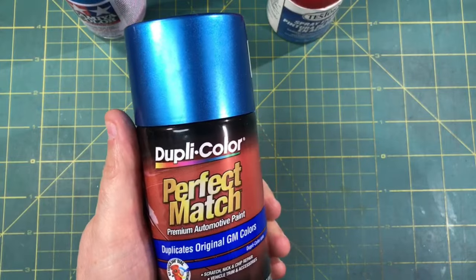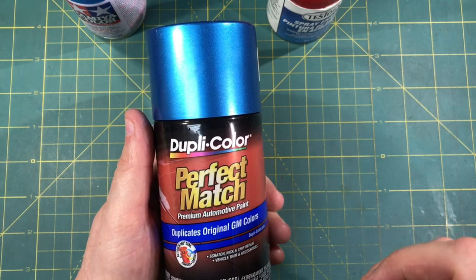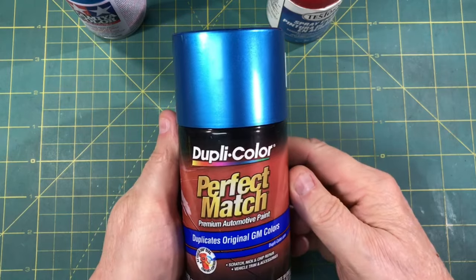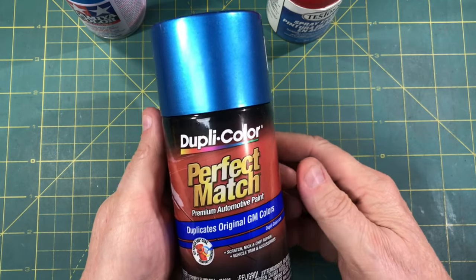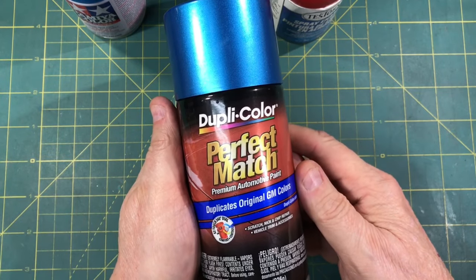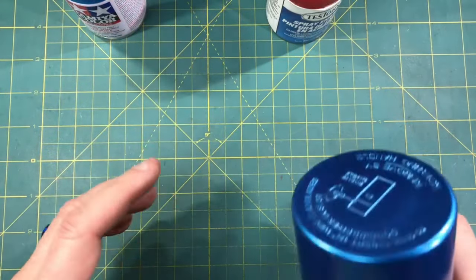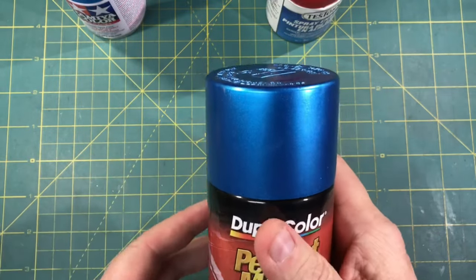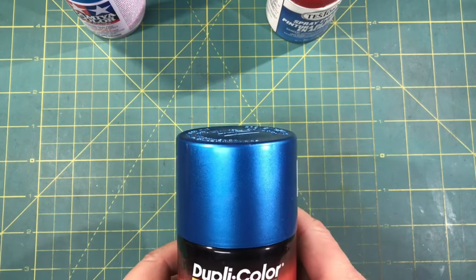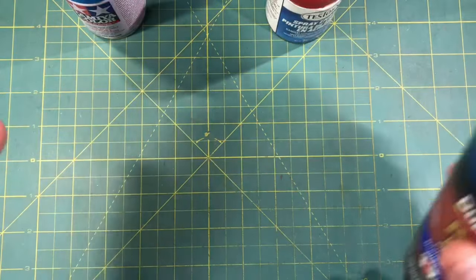I like to decant it, and I think my main reason is I like to put those ultra-thin coats on there. Multiple ultra-thin coats, at least for me, seem to yield a much, much better finish. But the biggest reason is I'm cheap, and there's a lot of waste. You ever noticed all that overspray when you're spraying down something? And I do use rattle cans. I use them when I'm doing chassis. Sometimes entire bodies, I'll do with the spray cans and get a great result. But you have large, flat surfaces, and it's easier to do.